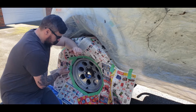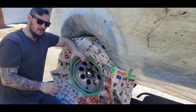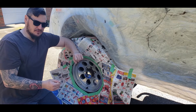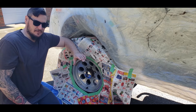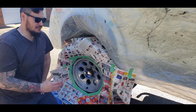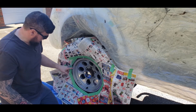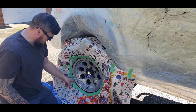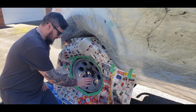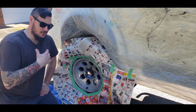You'll notice I covered the tire. You could just paint it too — I've done it — but it kind of looks horrible and the plastic starts to peel off. One thing to note about Plasti-Dip: if you get it on thick it's fine, you can usually peel it off in strips. If you put it on too thin it's a nightmare to get off unless you have a dip dissolver, which is super expensive. So cover everything you don't want overspray on. I left a little bit of the tire exposed because at the end I'm going to peel it off and it'll leave a nice clean edge around the rim. The next thing I'm going to do is clean this up with alcohol and then we'll start with the coats.